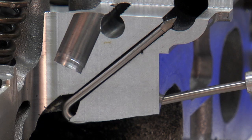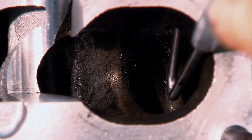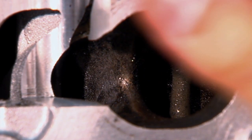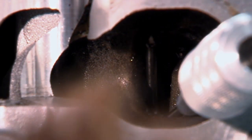When you transition from one hole to the next, it's important that you go all the way back in with the tool, rotate to the center, and pull out. Re-insert the tool into the valve pocket you're cleaning next, rotate the tool over to where it clicks into the big hole, transitions into the crossover port, and wiggle it to break through the carbon. Sometimes you have to do a lot of side-to-side movement. Continue until you feel it break through and pull it all the way up to ensure the entire length of the crossover port is cleaned out, then come back into the pocket, rotate the hook to the center, and pull it straight out. You cannot transition from one port directly into the other, because you'll be at a severe angle and will end up bending the prong.